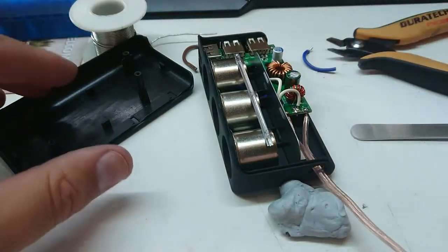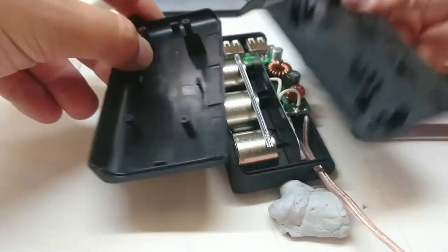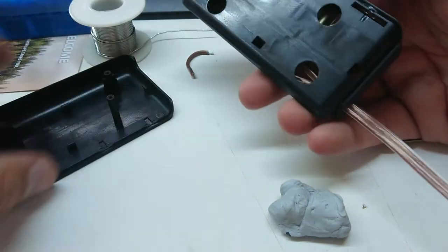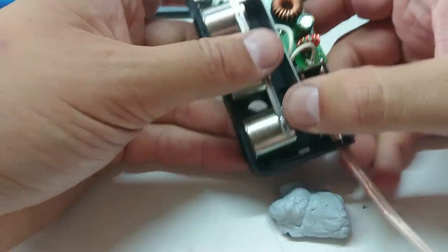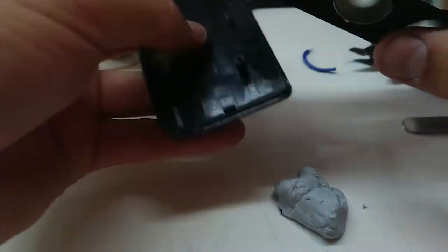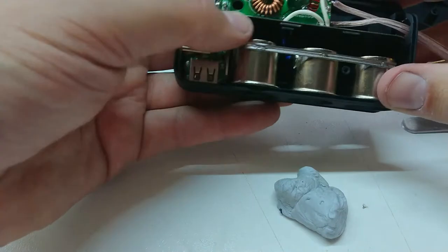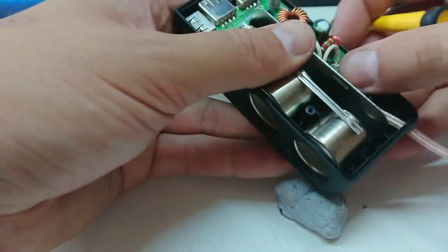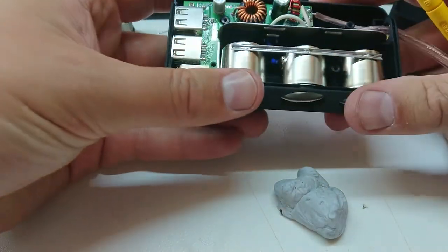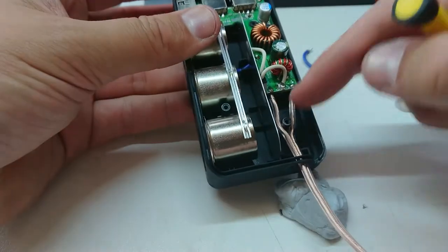We got it back in. Removing both of the clamshells doesn't really help all that much — that frame actually has a bottom on it; there weren't any stickers under there, it was just clipped in with four little clips. This is all pretty well friction fit. I have reinstated the little screw here. I'm going to put the bottom half of the clamshell on, then I'm going to run the wires around this screw standoff and put a dob of hot glue in here to use that post as a strain relief. There go our little clips to clip it in position. So that's good — a little bit of hot glue, and then we'll put the merit plug on.